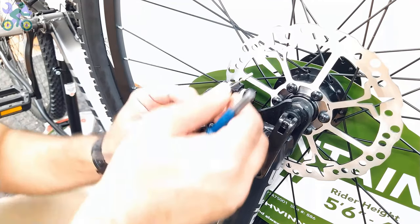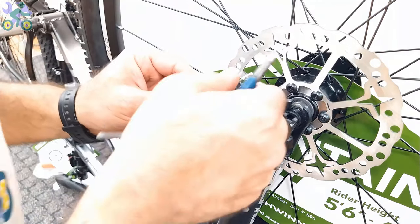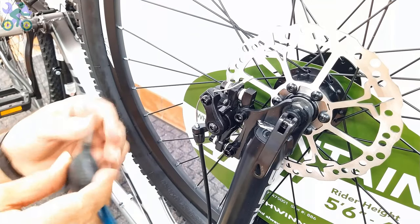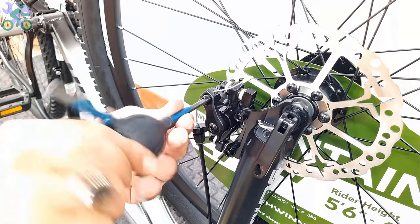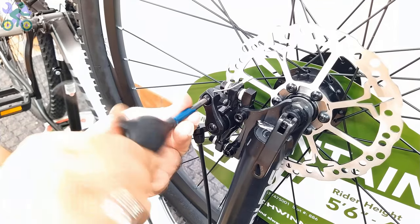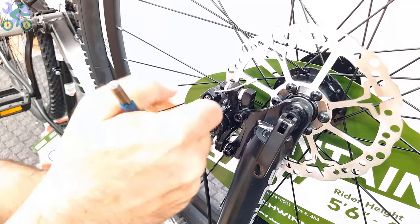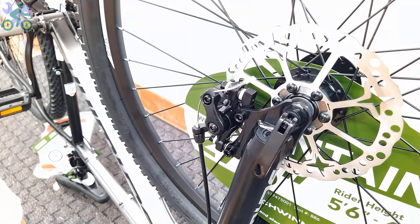If the brake wire was out of place and the brake wire was still loose after tightening the anchor nut, turn the bike upside down to have a better view and put the wire in its place. Adjust the brake and tighten the nut.